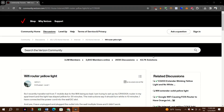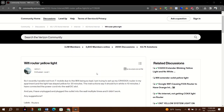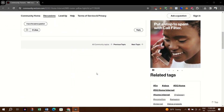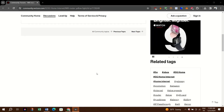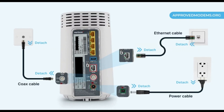In this video I am going to show you how you can fix yellow light on Verizon router. Try power cycling the Verizon router — disconnect the router and ONT from the power, wait for 1 to 2 minutes and re-plug it in, then wait for it to boot up and the Verizon router lights to return to their normal state.